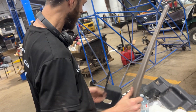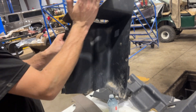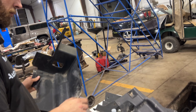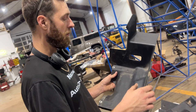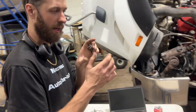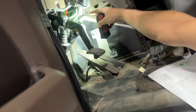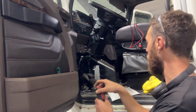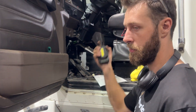Once this comes off, you can get the other panel off — except there's one other thing that's going to get you: the steering shaft comes up here and you just won't be able to get it out. So put your steering wheel at 12 o'clock, and you might want to put a strap or seat belt through it so it doesn't spin. Go ahead and remove this bolt — there's a slot in the steering shaft where the bolt passes through to keep it lined up. Use a sharpie to mark it so you know where it goes back on, and don't spin your steering wheel around when you get that off, because you'll mess the clock spring up.